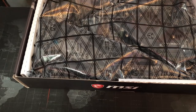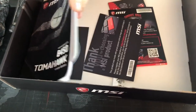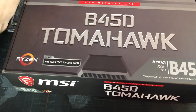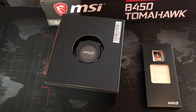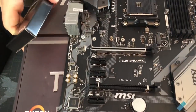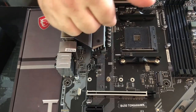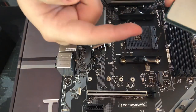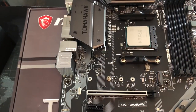Alrighty guys, so we're going to start off with unboxing the motherboard. When you open everything, you should see the motherboard right in the front of the box. We're going to open the bottom layer to get our IO shield and our SATA cables. You guys can install the drivers off the discs, but normally you just go to the manufacturer's site to install the drivers there. We're going to take the static bag off and install our CPU. First we're going to open the lever on the CPU header on the motherboard, and just pull the lever up. There's going to be a little dot on mine — it's going to coordinate to the CPU gold triangle on the bottom left. So we're just going to drop that into place and put the latch back down.